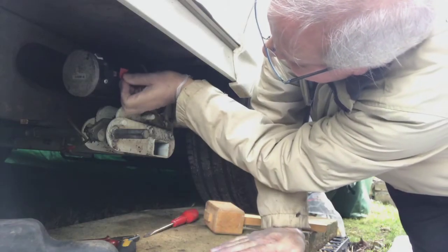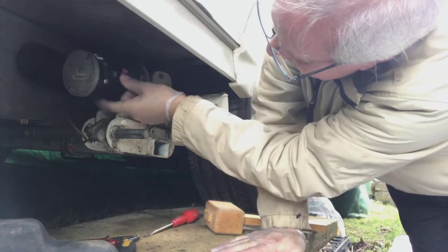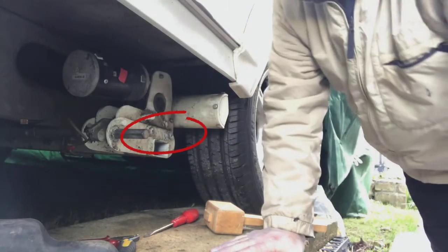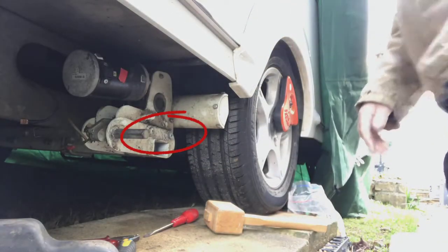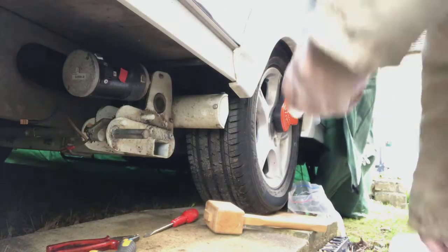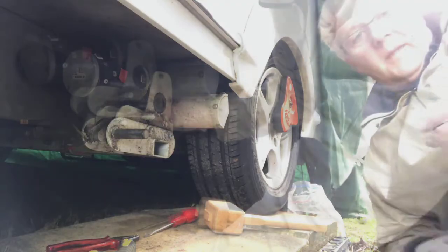After I've stuck this on, I need to remove the two main horizontal bolts that run through the whole assembly. The threads for these are actually in the back plate, but there are lock nuts on the back, which I found actually just dropped off when I unwound the bolts and pulled them out.